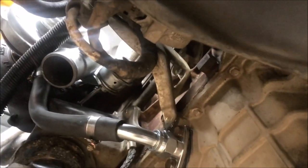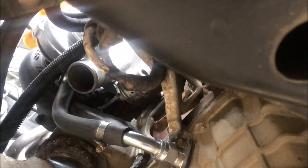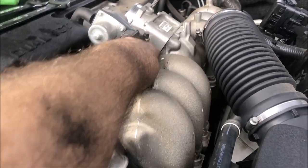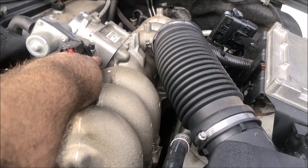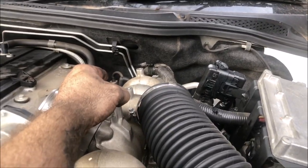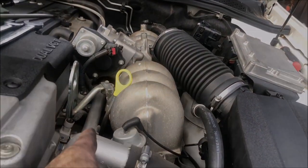So all my oil and cooler lines are done. Turbo's mounted. Manifold's on. I've got to get my bottom intercooler pipe, sort out my exhaust to make that fit, and then on top I've got to remove the throttle body so I can replace the MAP sensor with the turbo one — which is two-bar. I've also got a four-bar fuel pressure regulator to replace the NA one, and I've got the injectors. So the injector rail has got to come out.